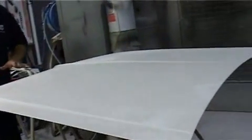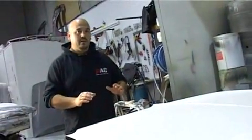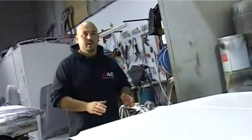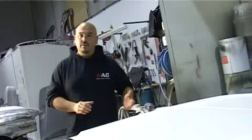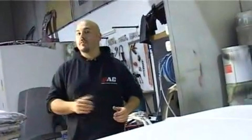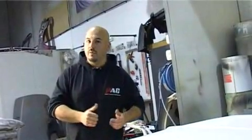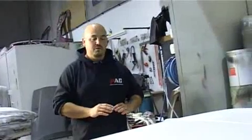Another cool project in the making is a two-door Galaxy that we're working on. This is the bonnet for it. It's in its second coat of high fill, so now it's just ready for its rub back. The way this car is going to be painted, it's going to get painted in gloss black first, just to see if there's any ripples in it. That's how serious this guy wants to get. Then we're going to block back the car again and paint it with the Holden effigy color, which is a gorgeous, like a wineberry sort of color. Brett's WRX is painted in the same color as well, which is actually where he stole his color from, this guy's car. When you see this Galaxy, it is to die for.